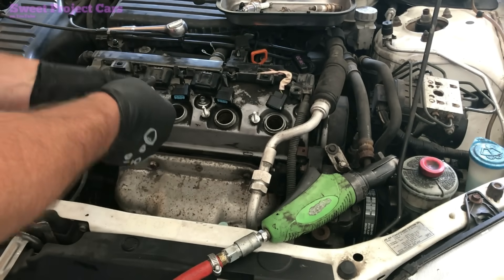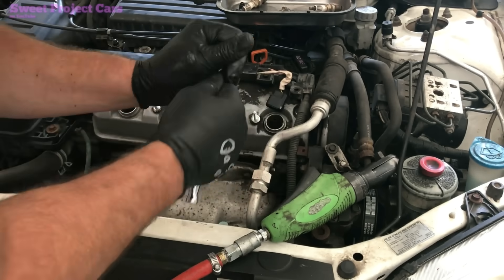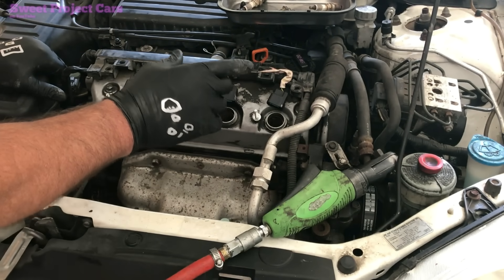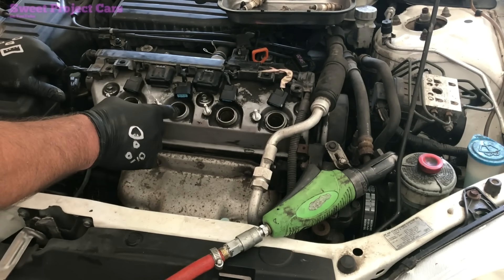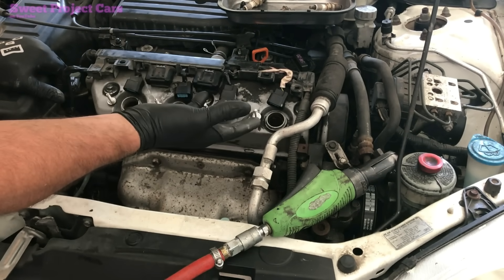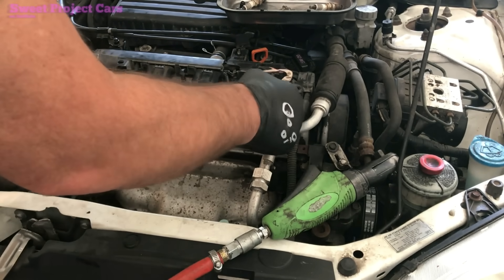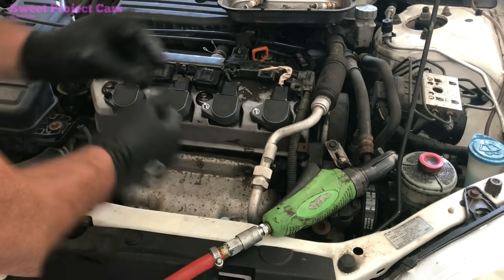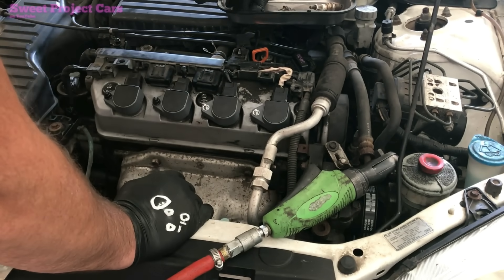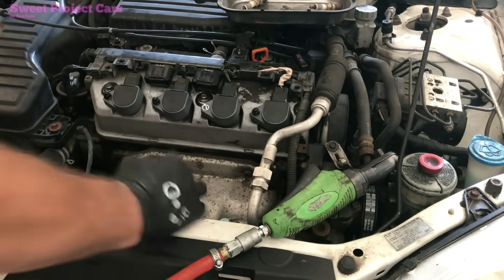You can save yourself hundreds of dollars doing this yourself. Those are done. I'm going to put the new coils on with the new plug, since we found that really bad plug, and fire this thing up to see how it runs. It may not need the injectors — if it still has a misfire, then we'll do the injectors in another video. We're going to put the nuts on — and of course I dropped every one of them. That's what happens, and I'm not deleting that part. I can see it down there — I'll get my long magnet and pick it out.